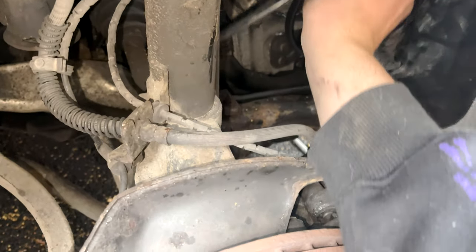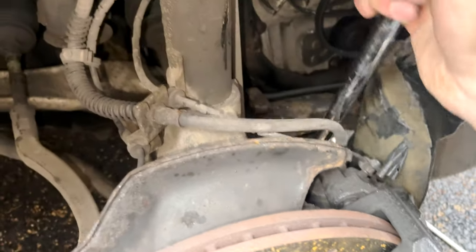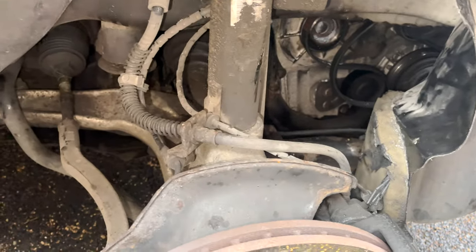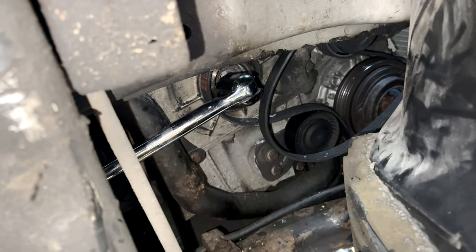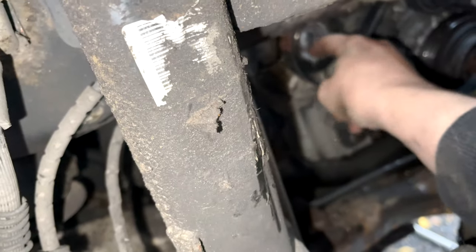We've got her out! How pleasing is that! I'm literally shaking, I'm so pleased with myself. So what I did - I wedged this up against here, basically like that with a 22mm on it, cranked her over and took her off. However I'm a bit worried about all that residue on there - I think it might be anti-seize but she's off, thank god for that.